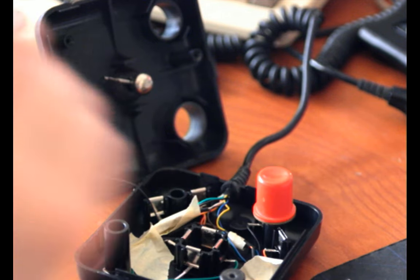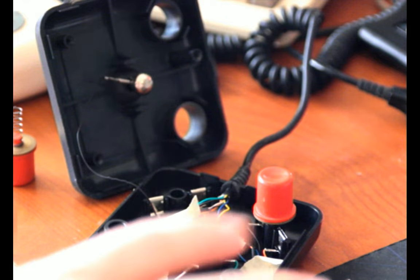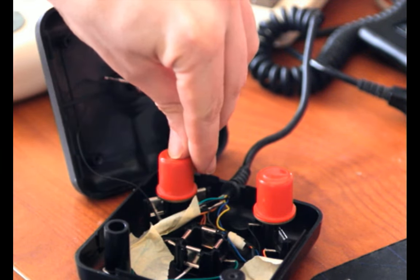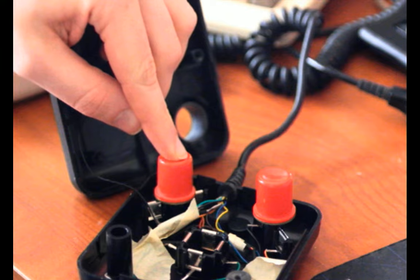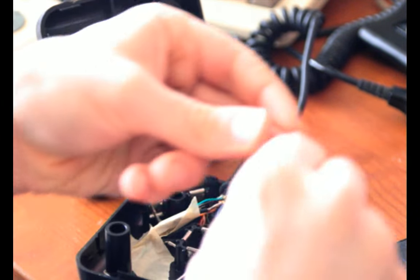Suncom advertised that this was a tactile switch. A tactile joystick. It kind of is, in that you can definitely tell when you've hit a contact point. But I'd argue it's not. I'm very particular about it, and it's easy to disengage the switch without realizing it, or to rock the switch ever so slightly in one direction and lift it off of the pad. And maybe that's just because I need to clean the brass, actually. That's something people recommend you do with these.